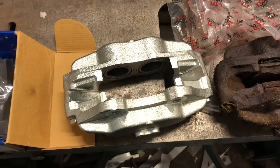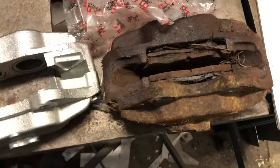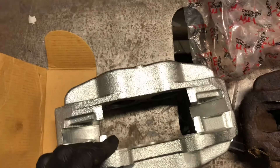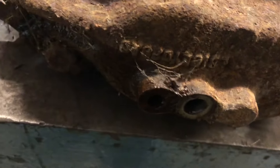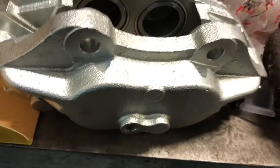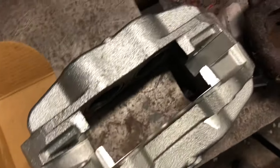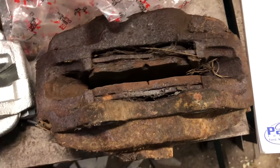I've got new calipers. I can't actually find Mark III Transit calipers anywhere — these are actually Land Rover Defender 110 brakes, exactly the same other than where the hose goes in, it's a slightly different fitting. So I'm just going to trim down the banjo bolt and fit it in. It's the only thing I can do without sending these off to be refurbished, which I think I'm well past anyway. They're literally a direct fit other than that.